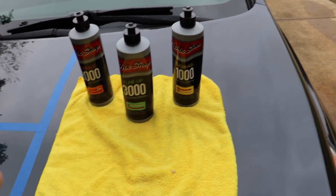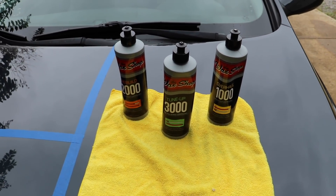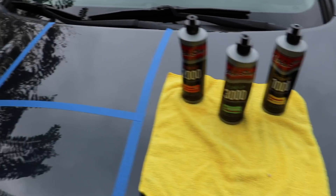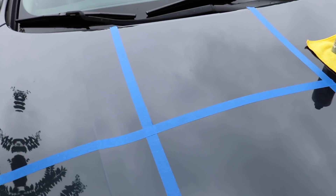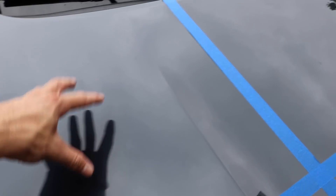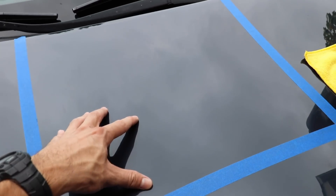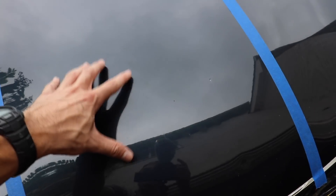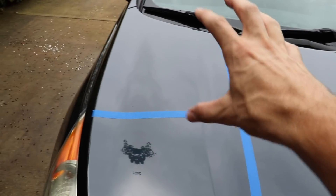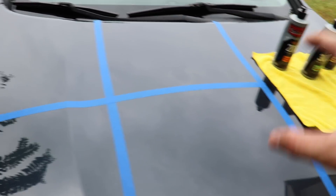It's basically a three-step polishing compound process in paint correction — we go from most aggressive to least aggressive. What I'm going to be doing is using my own car that I've let kind of go, so we have a ton of imperfections and scratches. In each of these squares, I'm going to use one product on top of another. In the first square I'll use just the 1000 Overhaul compound; in the second, Overhaul then the 2000; in the third, 1000, 2000, then 3000; and in the fourth, all three and then their carnauba wax on top.